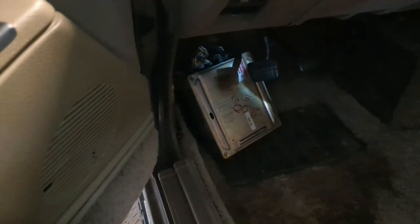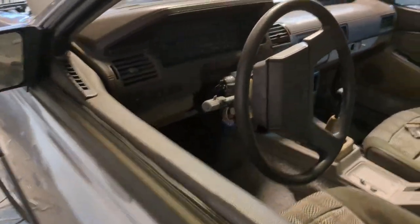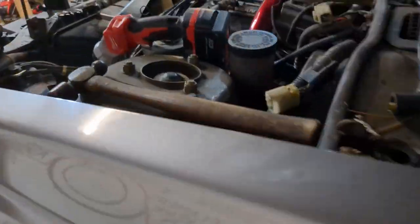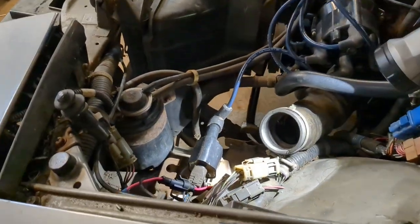So we plugged that sucker right on in to make sure that all of our hard work was justified, and the cost and all this wonderful digging. And we checked the coil driver, and wouldn't you know it, both coils are showing positive and ground. No more showing positive and positive on the intake coil. So it should fire right up, right? We put on the new spark plugs, we put them in the right order, and we go to turn the key.